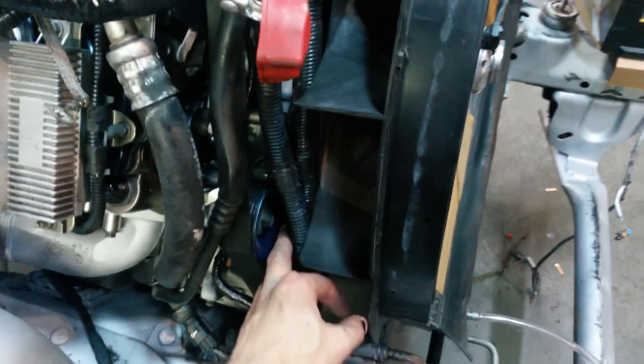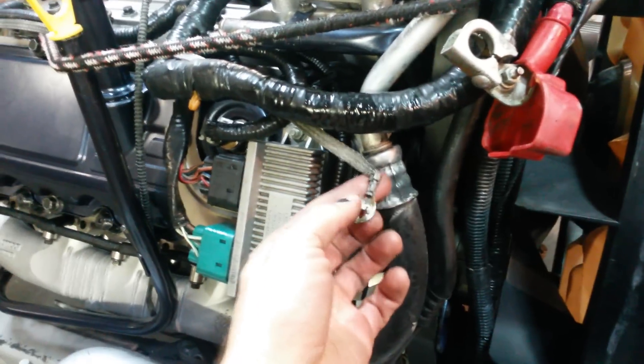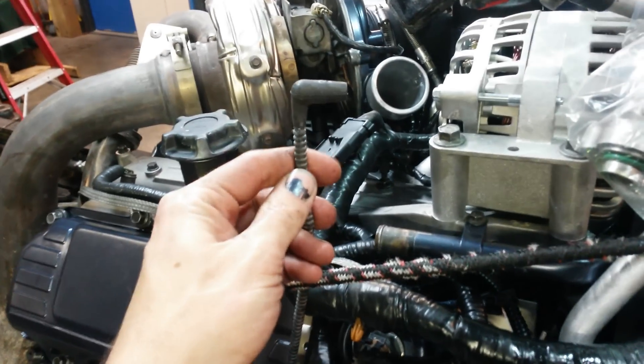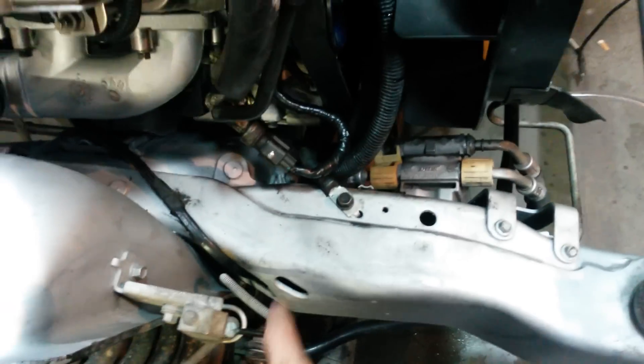Over on the passenger side, we have our positive and negative battery lines up and with the engine — they can sit right in between the belt and the fan shroud. We've got our two AC lines, a small one and a big one, up and with the engine. We've got our block or head ground strap. You want to make sure you have that accessible so you can put it back on, and especially this vacuum line for the driver side four-wheel drive — you want to make sure you have that up. It's a real pain to get to it from up there if it falls down.